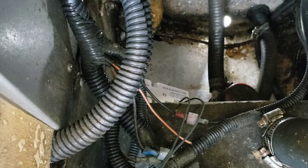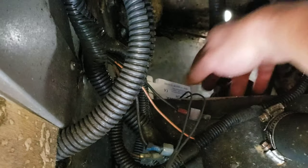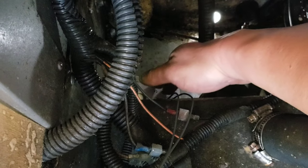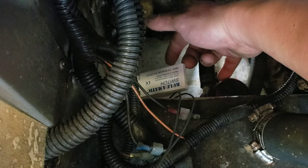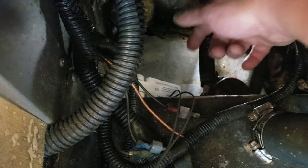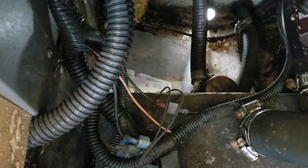You see right there is the float switch for the bilge. There's the water. That's the scuttle plug hole. You can see where the water would drain out. As you see, the water rises, it turns the switch on. Water lowers, turns it off. That's a float switch. I just glued it right in there. See if I can get a better shot of it.